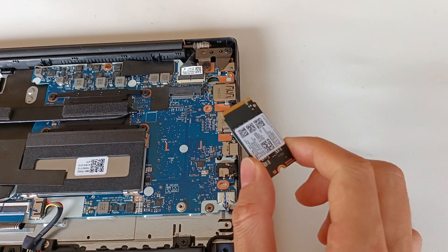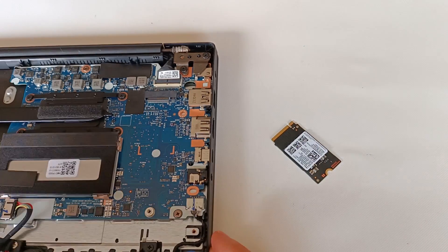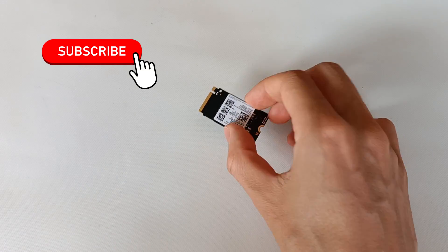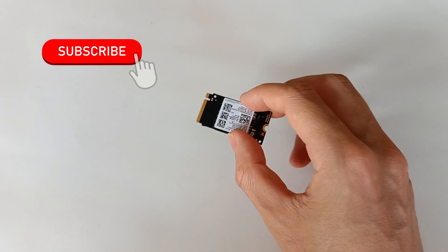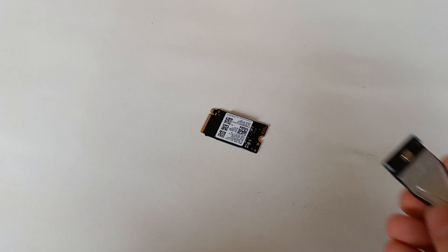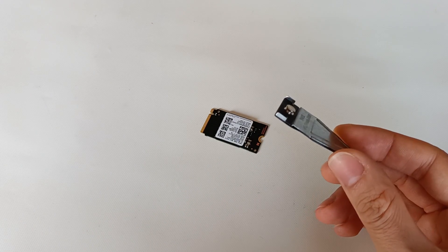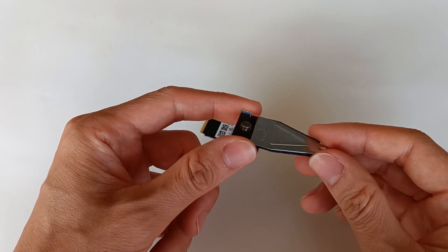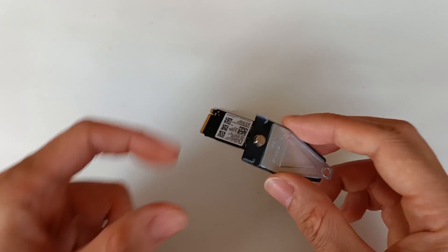For this I will need an extender to get the size 80 mm to be able to mount it. So we are going to need this component — an extender for M.2 modules. This is specially for mounting 2242 M.2 SSD modules.